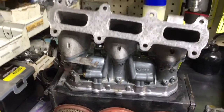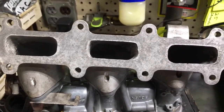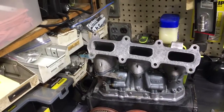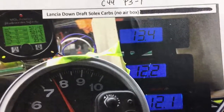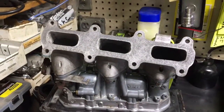The Lancia is kind of a rare carburetor. The one thing that's unique about the Lancia is it doesn't have any shared porting — each cylinder is 100% individual for the intake. So if we look at the jetting here, you can see it's pretty close. We've got a 13-4 on the top one, which is not unusual to see a little bit of a change on that.